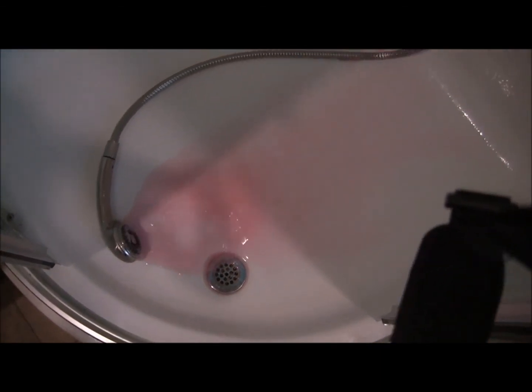Yep, see, still got air. So let me go and check the gallons again. Okay, now we're getting a better flow. That hose isn't very good that comes with the kit. It has memory, so it's coiled up in a roll, and sometimes it works its way down into the jug, and then it coils up, and of course once you drain some out, it doesn't pull any more antifreeze in. So, still got some air in the line.